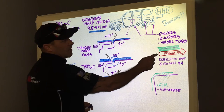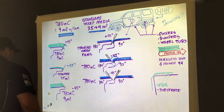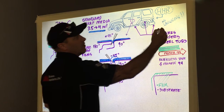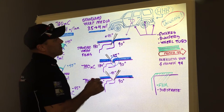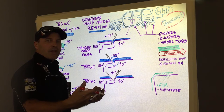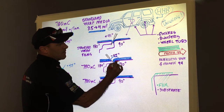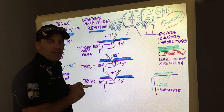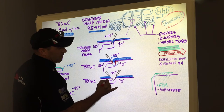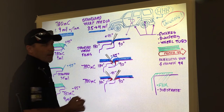As part of this whole process, I'm going to suggest that we use Primer 94 on any door jam or any edge that's been cut. In the case of the standard fillet on the 180 and tuck on the 90, you're going to want to make sure that you get Primer 94 placement on the turn on the 90-degree side for adhesion promotion. You should probably also consider applying some Primer 94 to the 180 side to help lock down that filleted edge. In the case of the double negative 45, same thing — put some Primer 94 on the 180 side and along the 90 side, just to lock down that edge.